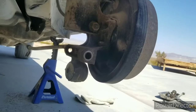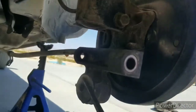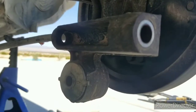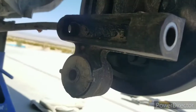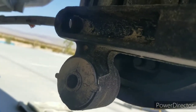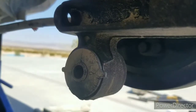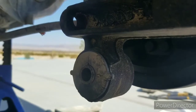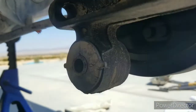You're about to do the bottom bushing on your Toyota rear hub — that's this rubber bushing right here. On many Toyota models including the Camry and a few Lexus models, it's also called the rearward trailing arm bushing. It's a rubber bushing with no sleeve — it was pressed in at the factory right into the hub. The only way to replace it with the factory part is to get a whole new hub from Toyota.